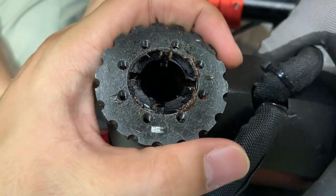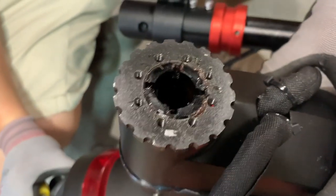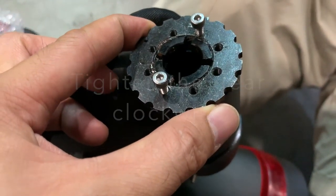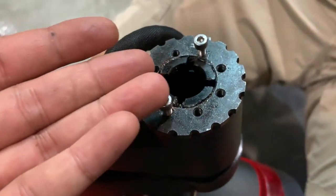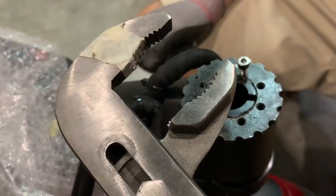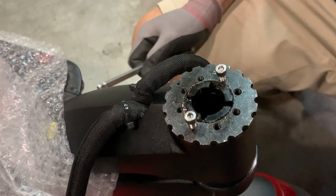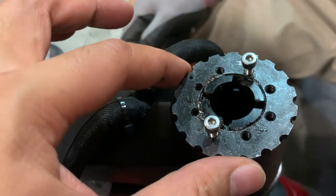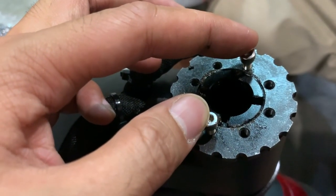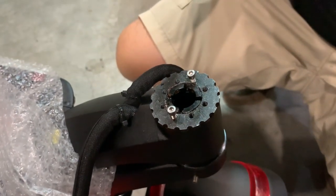Now, yours may not have the gears — yours may be a flat piece — but it will still have this housing here. So we'll teach you how to tighten up the holes. There are a few ways to tighten this up. If you have a gear here, you actually do not even have to remove the whole headset to tighten it. You can simply take an adjustable wrench like that and tighten up this whole gear. But if yours doesn't come with the teeth and it's just a smooth ring, then you need to remove the whole headset and set these two screws in to a point where they are not shaky. And we'll show you how to tighten it.